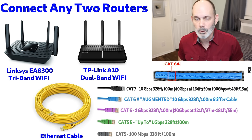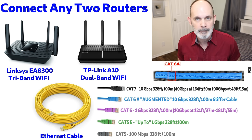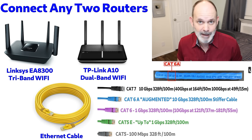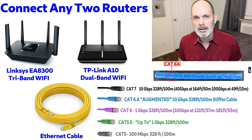Since I've upgraded to one gigabit internet speed, I'm amazed at how many times I've noticed that if I throw a cheap cable onto my network it slows it all down. My recommendation is that you use Cat 6A — category 6A cable — as you see here on screen. Anything will do, but on a gigabit network a Cat 4 cable would really choke the speed.